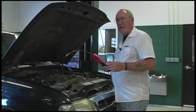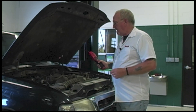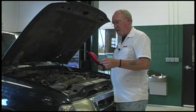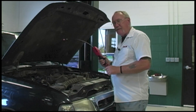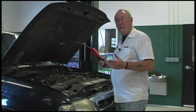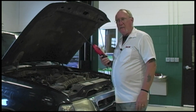For EVAP leaks, a lot of us will stick the tip up into the drain tube for refrigerant detection. If there's a big leak, that works just fine — just don't get water in the tip. But if there's a small leak, you may not find it that way. So try this tip: plug off the drain tube and let the vehicle sit for 30 or 45 minutes. Then, with your sniffer right there at the drain tube, remove that plug and see if you get a reading. Refrigerant is heavier than air, so it sinks to the bottom of the evaporator case where the drain is. As soon as you pull that plug, it has a way out and you'll be able to pick it up.